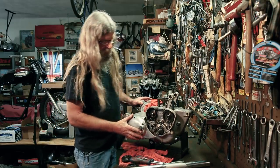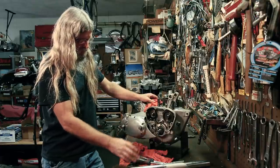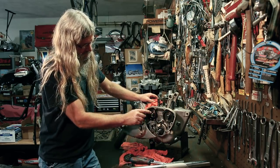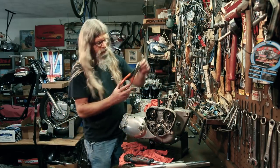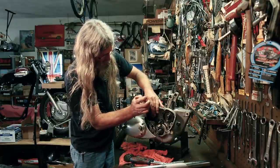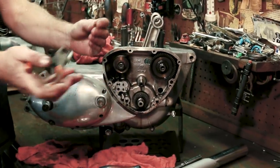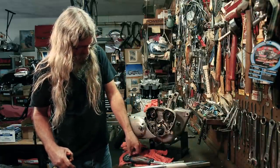Generally as I take these apart, I'll get one of my cardboard boxes and just set everything in the box — this one goes here, this one here, this one in the middle, this one at the bottom, with the keys and all the parts. Here's the key right there. Use side cutters to carefully pry that little key out of the keyway on the end of the cam, and put that with the gear we just removed.